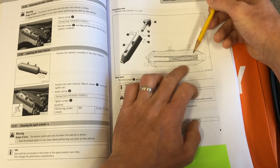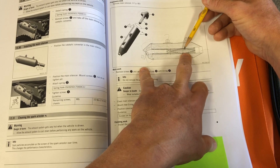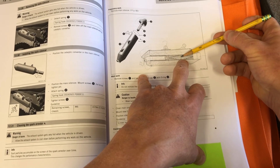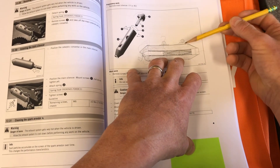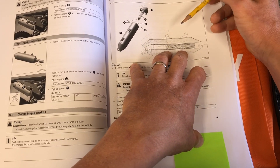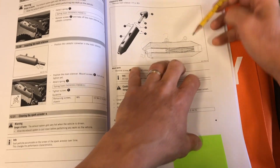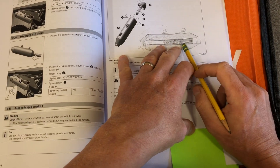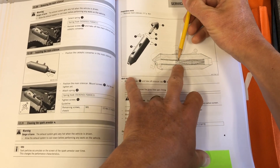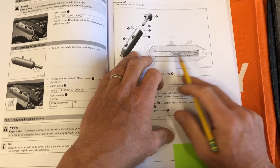Leaving the resonator in benefits and improves low to mid-range performance and there's also a huge sound effect — removing it will make your pipe a ton louder. Who should leave it in? Guys who need sound dampening or want to preserve their low to mid-range throttle response. If you want wide-open power — supermoto guys, flat track guys, high-speed guys — take it out or go to an aftermarket pipe like an FMF or Akro. Removing the resonator will dramatically change performance and sound.